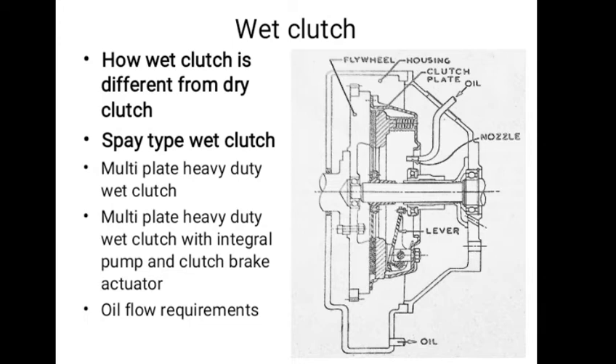Since the value of friction coefficient decreases due to the presence of oil on the friction surfaces, thermal limitation because of the poor oil distribution to the more remote friction surfaces makes this type unsuitable for a higher number of clutch plates.